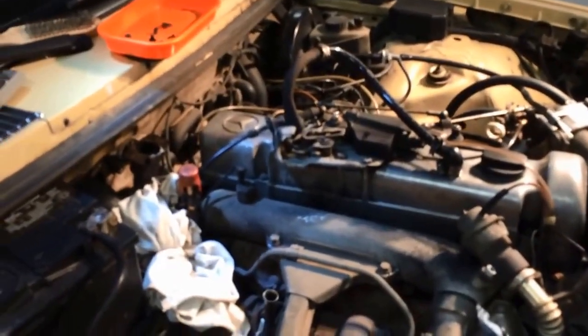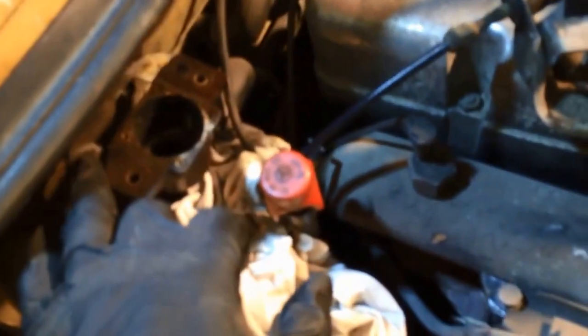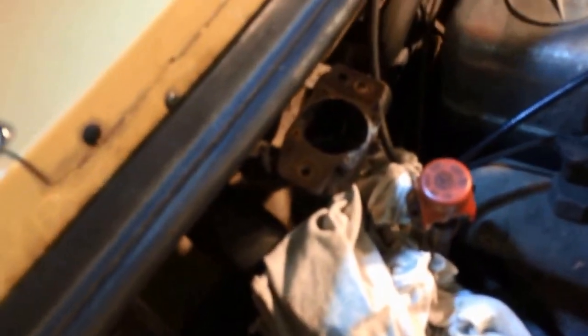So this is a live error. And yeah, we'll keep going here. Okay, update. We took the MonoValve out of the housing. We removed the mounting housing bolts, pulled it out, took the little screws out, and we took it out. Here's what we got. This is the MonoValve. Sorry for the blurriness. This thing is really corroded. The seals look intact, but it looks really ugly. We're going to try and pry it out of there and clean it and see what we come up with.